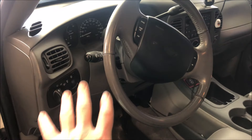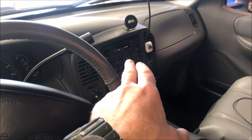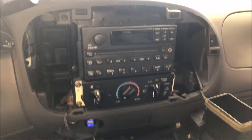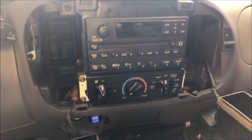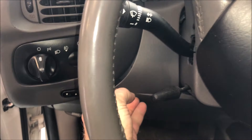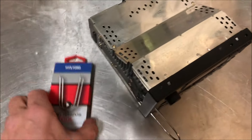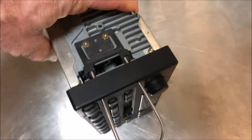Now that the double DIN unit and sub panel are ready, I need to dismantle the dash. That requires getting all these plastic bezels out of the way because the sub panel is integrated underneath the overall dash piece. I've pulled the radio bezel off — it just pulls straight out with push pins. Next I'll get the radio out using a special tool that enters into two locations, which I'll link below. The next easiest part to remove is the panel below the gauges — you just pull it out — and then there are screws to remove to get the radio out.